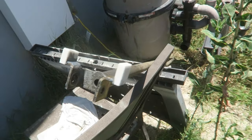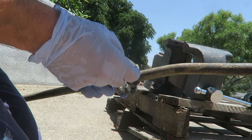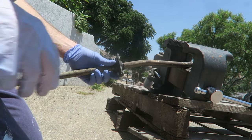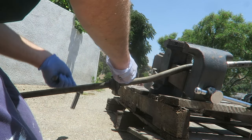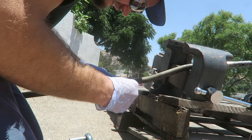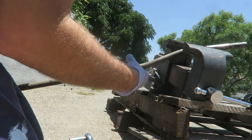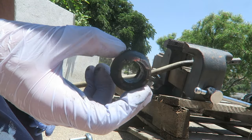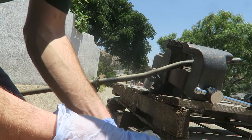With the elbow selector thing removed, I can now slide this all the way off. You can see this is where the old bushing sat — it's all crumbled and falling apart. Here's a new one I got from GoWesty. It's made out of Delrin. We're going to go ahead and install this — looks like it's just two 13mm bolts holding it on. Slide this guy off — yeah, this thing was in rough shape. I'd definitely say it's time to replace it. I got some grease — I'm using this bicycle grease. Everyone says it's really good on plastic and parts like that where you don't want to use actual grease.